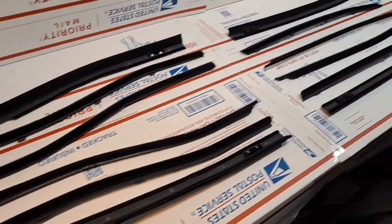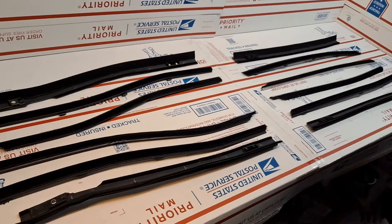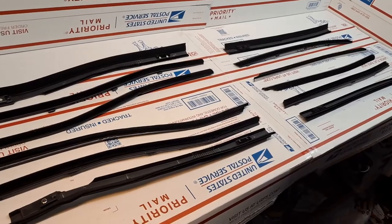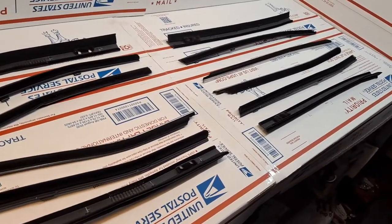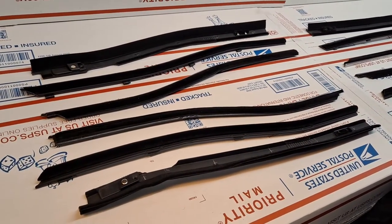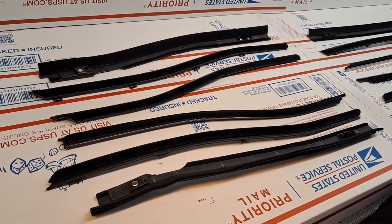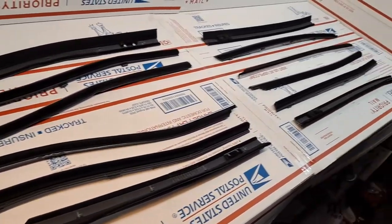This is George in Florida. I have over 75,000 original vintage parts for the 1967 to 1978 Cadillac Eldorados. These particular rear window sweep seals are specific to the convertible variant of the Eldorado, which is a 71 to 76 configuration, as 76 was the last year for the Eldorado convertible. The 77-78 last two remaining years for the large Eldorado had only the monolithic front windows with a sealed stationary rear window and therefore no replaceable sweep seals.